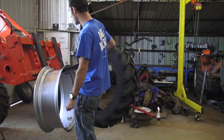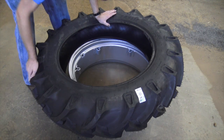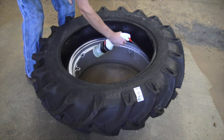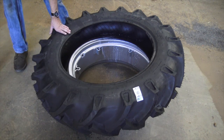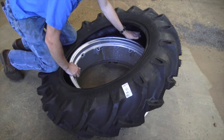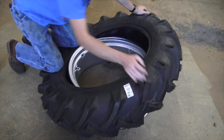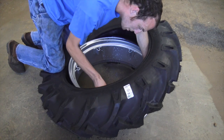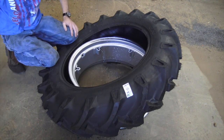I'm not entirely sure what I'm doing, but I'll take you guys along for the ride. If this is anything like the smaller tires, the first thing is to stretch the beads out and then walk the bead over the end of the rim, with plenty of soapy water to help things slide. It's actually going — oh, it stopped. I should have kept my mouth shut. I saw a guy on the internet use a hammer about this time — that really didn't work at all.